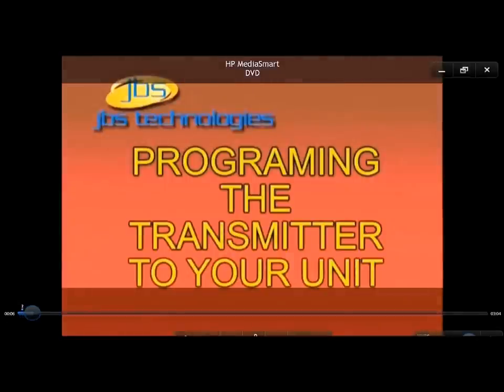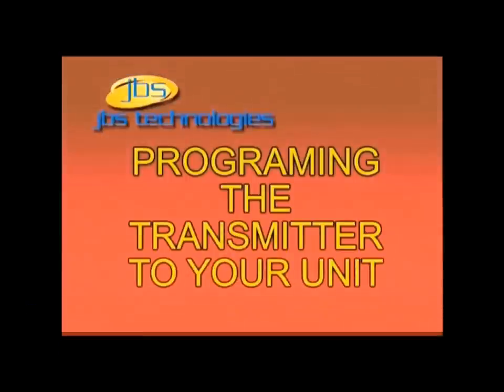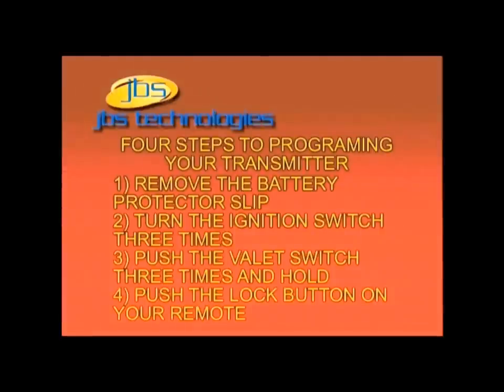Programming the transmitter to the control module. There will be four necessary steps to programming your transmitter. Step 1, remove the battery protective slip. Step 2, turn the ignition on and off 3 times. Step 3, push the valet switch 3 times until the LED flashes. Step 4, push the lock button on your transmitter.